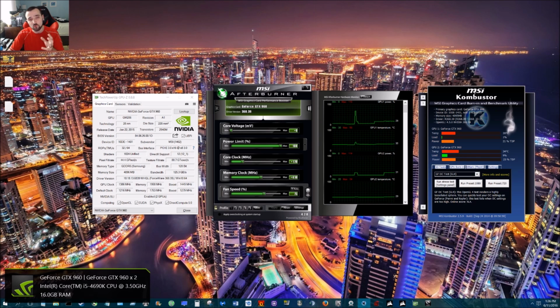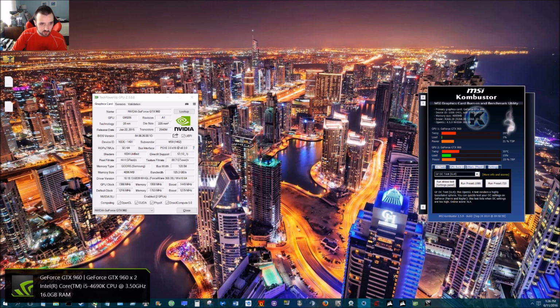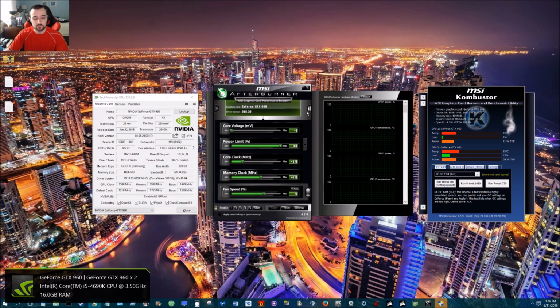Now, to overclock, you're going to want a set of tools. You're going to want some type of monitor, number one, to check on your temperatures, check on your loads, power consumption, etc. You want to be able to monitor your graphics cards for safety reasons, performance reasons, etc. So I recommend TechPowerUp's GPU-Z. It's free. It's awesome. It really is a great monitoring program for your GPU. Now, I'll link all these programs in the description.